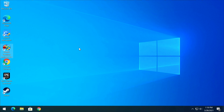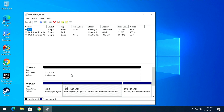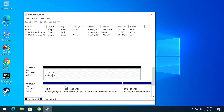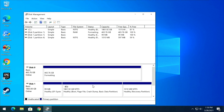Once we're in Windows, if this is a brand new drive, right-click the Start button, go to Disk Management, and find your new disk — you'll know which one it is because it says Unallocated. If it says Offline, right-click it and click Online. Then right-click and select New Simple Volume, click Next, choose the capacity you want, assign it drive letter D, and format it. Smaller drives take less time — maybe 5 to 10 seconds.